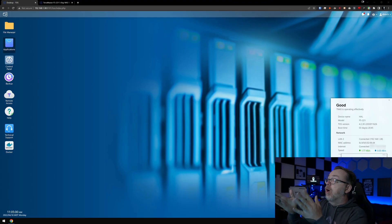However, if you want a good, solid, surprisingly well-performing media server with all of your storage attached directly to it — and I think it only pulls around 65 watts or something — let me verify that. It's got a 90-watt power supply. I've had laptops with bigger power supplies than that. So if you're looking for a low-powered, super-efficient home media server, the TerraMaster F5-221 is definitely worth a look.